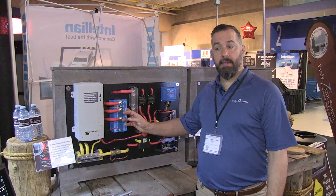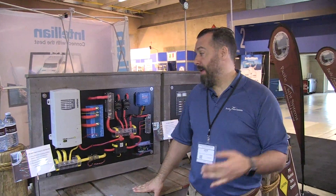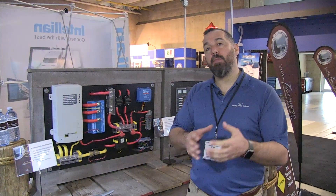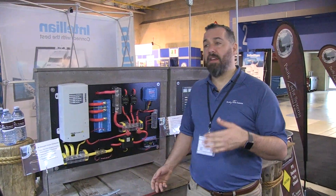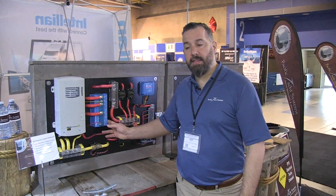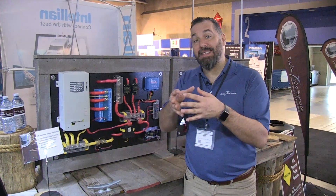This is a directional device. It's what used to be done with diodes, but now it's done with FETs, so the voltage drop is much less. Diode combiners used to do a 0.7 volt drop; this is going to be like 0.1. So you're not losing much on this, and it's a really handy device to recharge two battery banks from a single alternator.